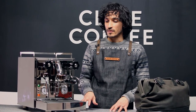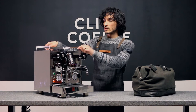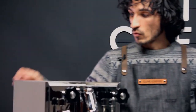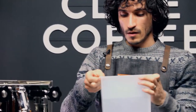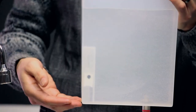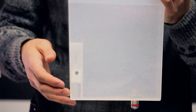When you are first using your machine and you fill that boiler for the first time, you will draw a lot of water from the water reservoir. At a certain point, the machine will turn itself off due to the low water level. All you have to do is simply take that top tray off and refill your water reservoir. There's a magnet float inside the water reservoir, so if it drops below a certain level, the magnet drops and the sensor inside will turn the machine off.